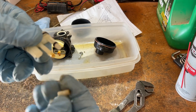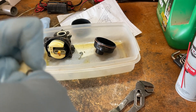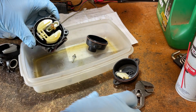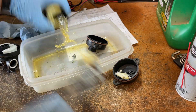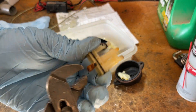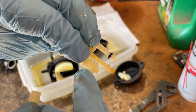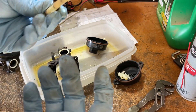That was in one of my past videos. I always hold on to stuff like this — just because it really comes in handy. We've got the good bowl. Let's see what kind of shape this one's in. Now the rest of this carburetor is probably still good. Oh man, this is stuck. Yeah, this is the worst I've ever seen one of these. It's all clogged up right there, clogged up down here. These holes aren't too bad, but there is a little bit of debris in one of them. So this is toast.